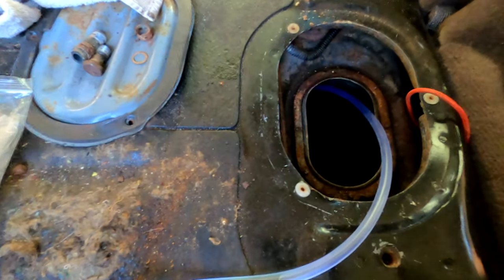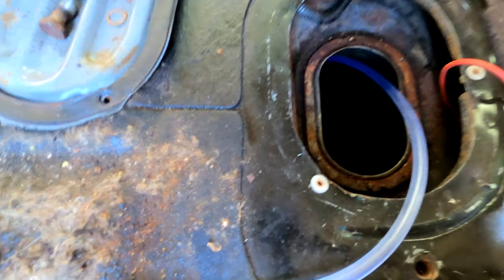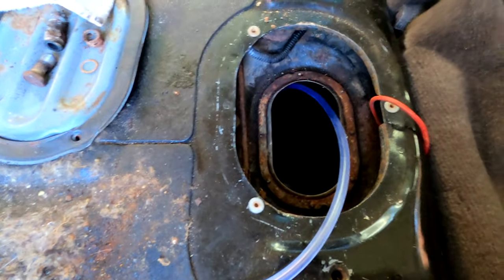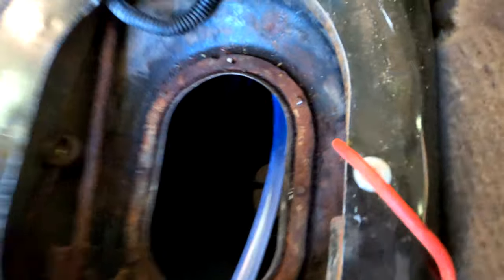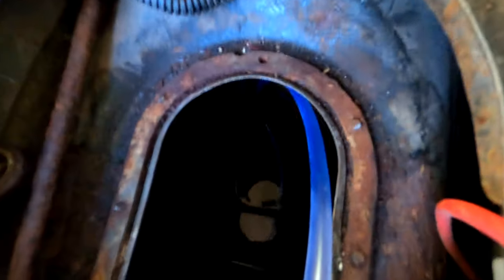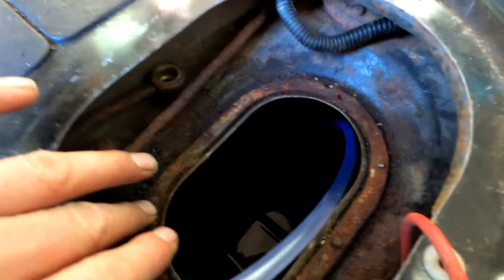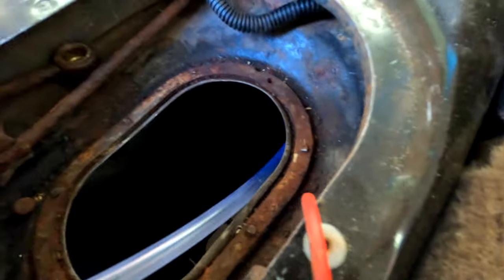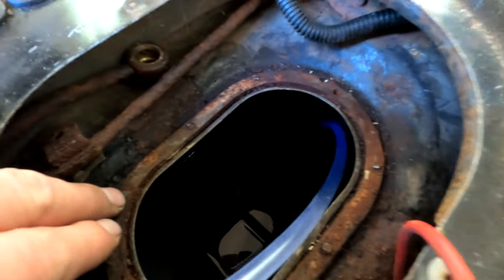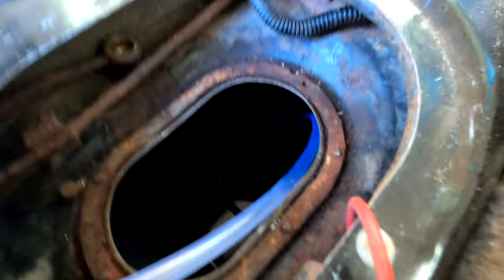Back on to this tank assembly I've been working on for months. There's a two-fold problem here: first, all these bolts snapped off except for one. These are actually M5 by 0.8 — not M6 and not M8. I got a center punch and we're going to try drilling through some of these and see if we can extract them. If not, we can helicoil them.